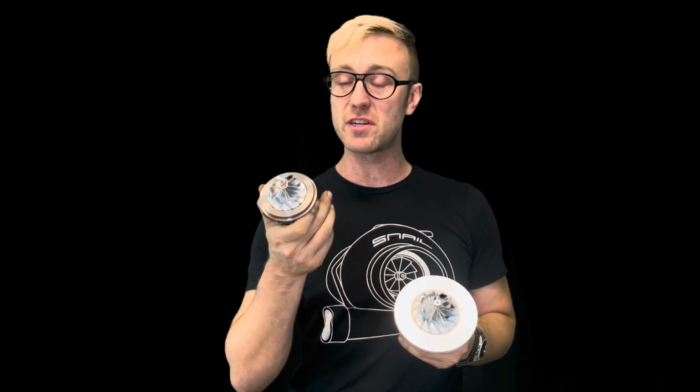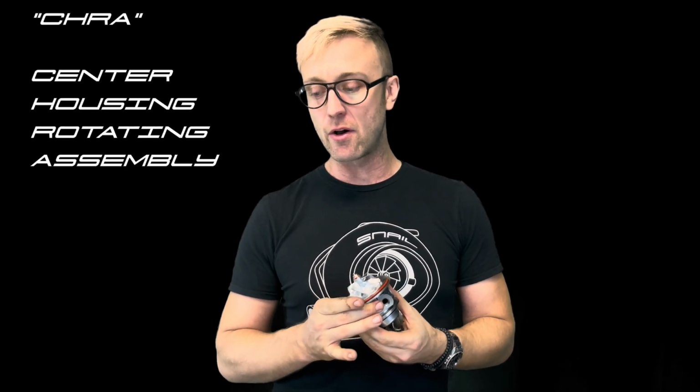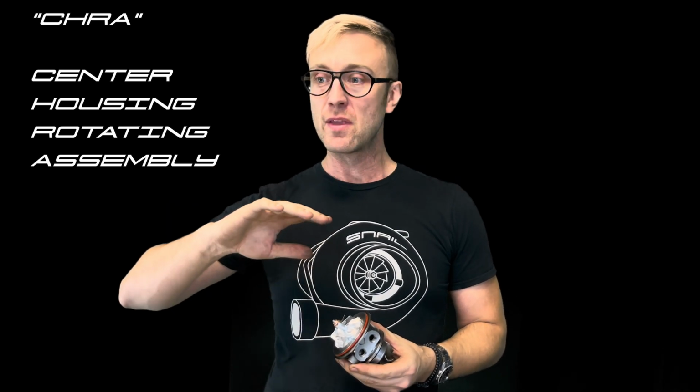I have the K24, K26, and the Mitsubishi TD04 19T here. Whether this be a TD04, TD05, TD06, or the K24, K26 turbo options, it's all going to be relevant. What I will tell you is, it's really important to make sure that you set up your CHRAs correctly. A lot of people go online and find different turbo setups that are unbalanced or not properly balanced, or the wrong wheel on the wrong turbine.